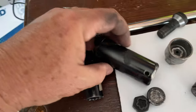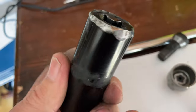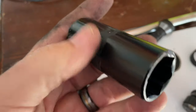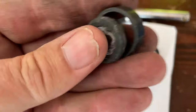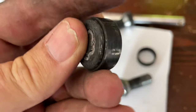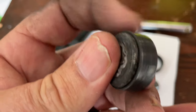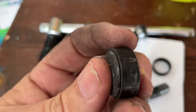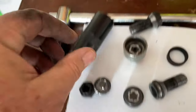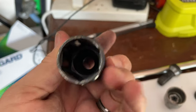The standard way of getting lock nuts off is to shove on not a six-point but a 12-point socket, ram it on over the top, and then you're able to turn it — or you can get lug nut easy-outs. But when you have this security ring, all you do is bite into that ring and it spins, and as you can see the lug nut does nothing at all. I belted the socket on and got a really good hold on the ring, which then spun and did nothing at all.